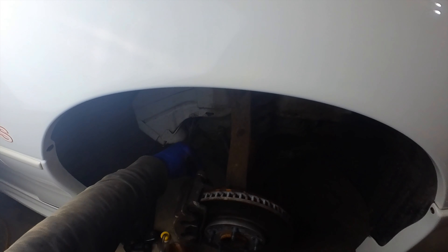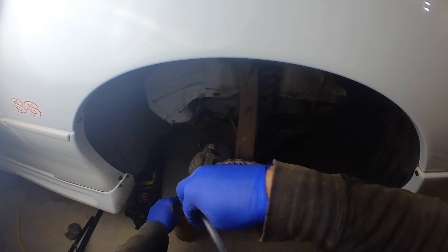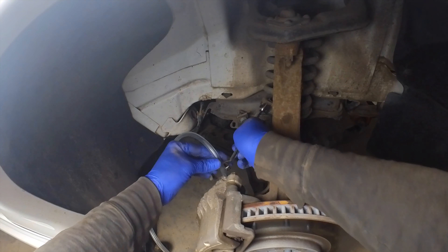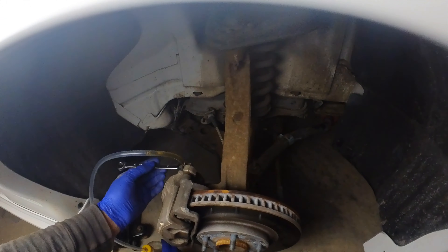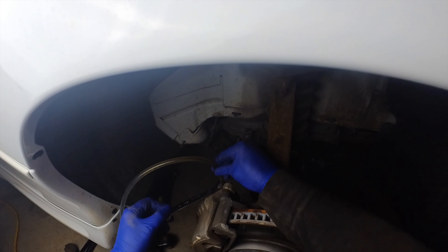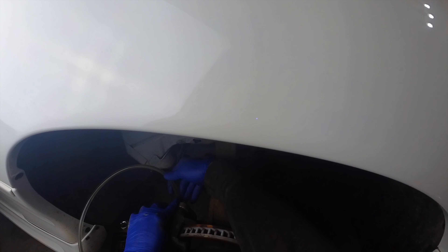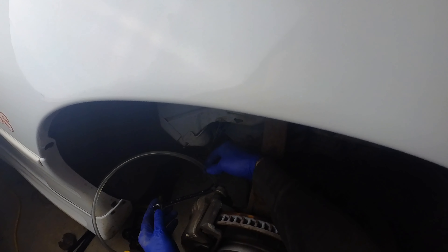Now we're on the passenger side front. We'll move the cover and we should be able to tell when all the old stuff's out. See how that's a fairly amber color — the new fluid is clear. It's starting to clear up now, you can see the difference in color. It's a little darker here than here, so we should have all the old stuff out. Just let it push a little extra out. Yeah, you can see a big difference. Cap back on.